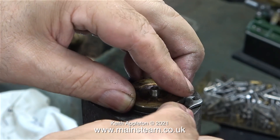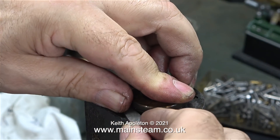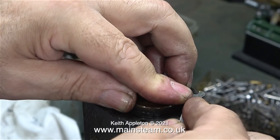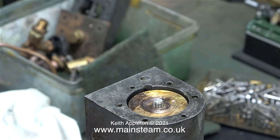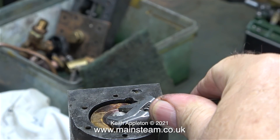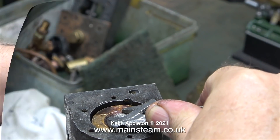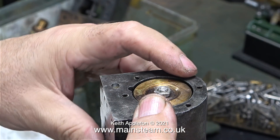I didn't use a piston ring compressor — I used the side of a spanner. There's a bit of a knack in doing this, but once you get used to it, it's very easy. It's a combination of putting downward pressure on the piston to hold the ring in position and, by doing this gently, slowly and carefully, the piston ring eventually fits in the cylinder. Now it's not tight, it's just a good fit, and I confirmed this by moving the piston up and down in the cylinder — it felt very good.